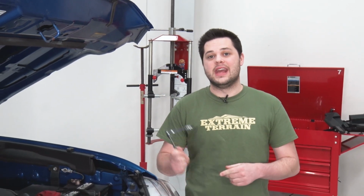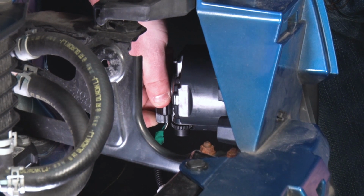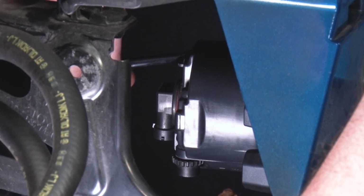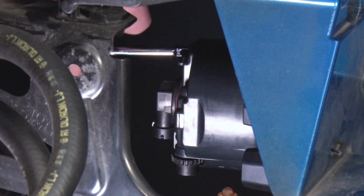You reach your arm right here behind the air dam. That gives you more than enough room to take out this one screw. But with that being said, we're gonna need a Phillips head. There's one screw holding our fog light to the bumper. While this is still attached to the truck, I'm just gonna remove the wiring harness by pressing down on this tab and dropping it away. Then we could use the Phillips head screwdriver to remove that one Phillips screw behind the fog.